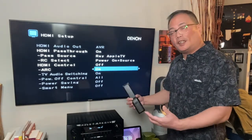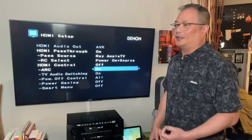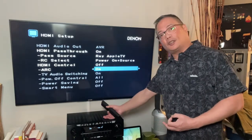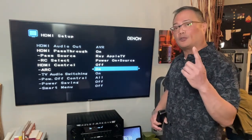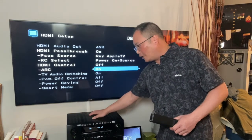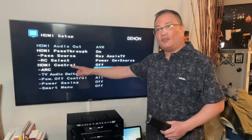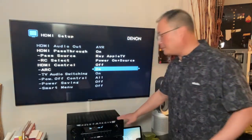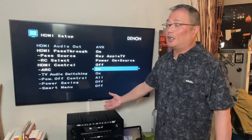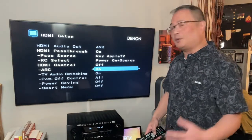I'm staying here and doing it slowly because this is the biggest question I get in the other video: how does ARC and eARC work? Did you check the back of your TV? Are you plugged into ARC on your receiver? And how are you cabling it? I always tell them I use one cable. I go from my Apple TV input into my AV, then out from my receiver — one more cable goes only to the TV. What comes from my wire management is only one HDMI, a power cable, and a network cable.